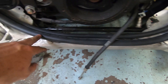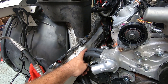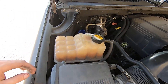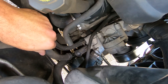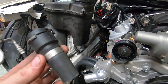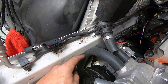We've got our hoses run here — we're going to tie these to the K-member with a P-clamp. Next we're going to talk about the expansion tank. You can either tee it into the upper or lower radiator hoses, or tee it to the heater hoses. I'm going to show you on a Tahoe or Silverado where GM would do theirs. This is Frank's Tahoe — you can see the stock expansion tank here, and this hose goes around and tees in right there on the front 3/4-inch port on the heater line. We're going to tee the BMW tank just like GM did. We're going to use one of the lines that came off the original heater — these have a quick disconnect and a straight connector. We'll cut this band clamp, put this on the tank, then get a 3/4-inch tee and plumb that in right here.